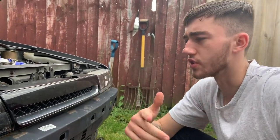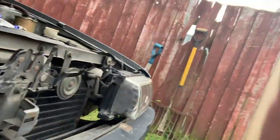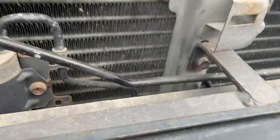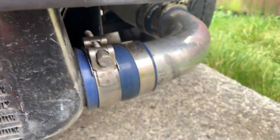Right, so the first thing I've got to do is take the bumper off, but the bumper as you can see is already off. Next thing I've got to do is just take this grill off. Alright, so I've got the grill off and now all I've got to do is just undo the bolt here, bolt under here, and just another one over here, and then just take the hose clamps off on either side of it — and then the thing should just drop right out.